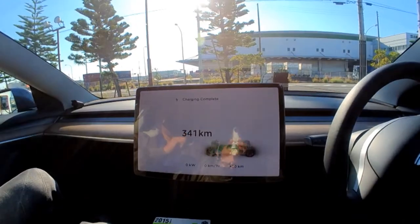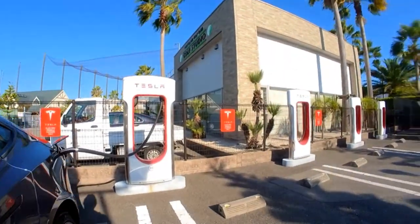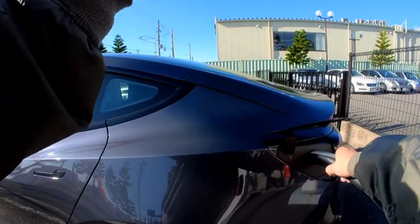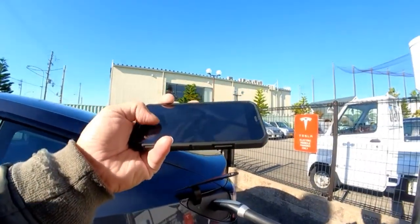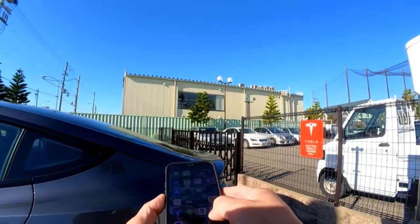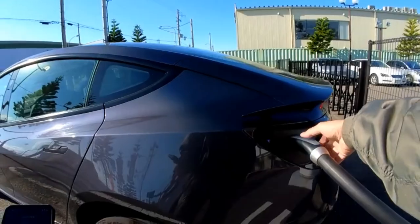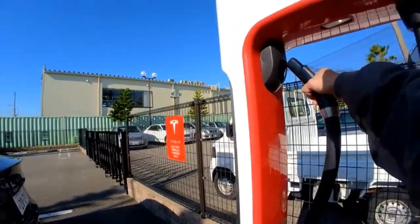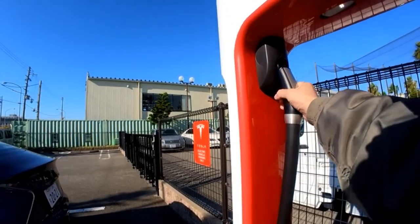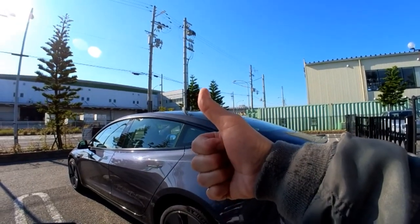To see how much you owe, just go into your Tesla account. Now, to remove the connector from your Tesla — notice this: you can't just pull it out, you need to release it. Go into your app, press charging port. When the charge port LED is white, you can pull it out, then put back the connector. And that's it for this video, guys — thanks for watching, like and subscribe to my channel, bye!